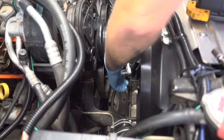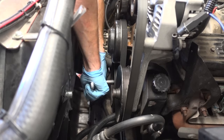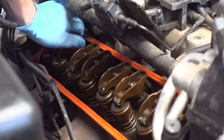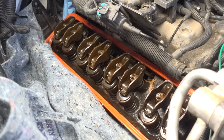I've got my half-inch ratchet and a 5/8 socket with a couple extensions, and I'm just going to push this down about 90 degrees. It's definitely not easy. Now we can go through and feel the push rods for excess play by spinning them and trying to lift them up and down. So far, I've rotated the engine 90 degrees about six times, and everything feels pretty good to me.